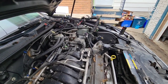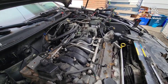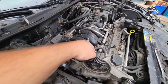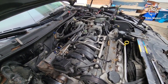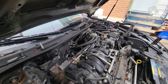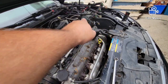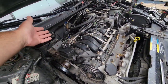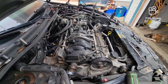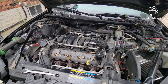We're moving along. I'm going to leave the air filter and the intake on for now. Basically to pull that intake off is literally a minute and a half with one of these - snap on, zip zop - and they just come right off across the board, both sides, some 8mm bolts and the whole thing comes up with the fuel rail and all that. All the wiring is already undone and pushed over out of the way nicely. We're already very close to pulling heads. Once the intake manifold's off, it's the exhaust crossover pipe, the two manifolds, and then the head bolts. Really not difficult to do on these things, believe it or not, because these things are really shoehorned in there as you can see. Anyway, that's it for now - enjoy the video and we'll upload the rest of the work after. Cheers.